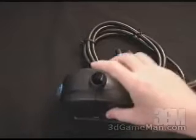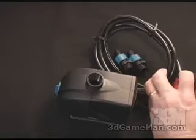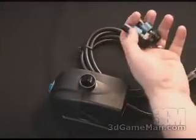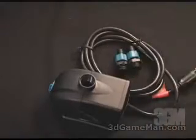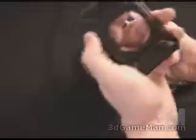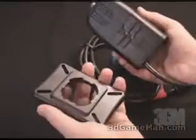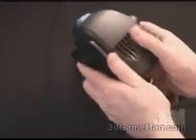In my particular case, I am going to start with the pump. This is the Hydor L20 185 gallon per hour pump. It also consumes around 11 watts of power. You plug this one into your AC outlet. It comes with a couple of fittings here for the tubes to be connected into the pump. The base on this one is detachable — you can mount this to the inside of your case, which makes it very simple to remove or attach the pump.